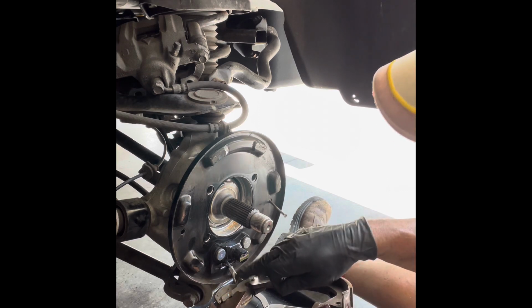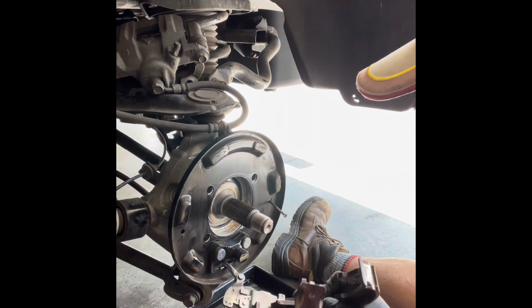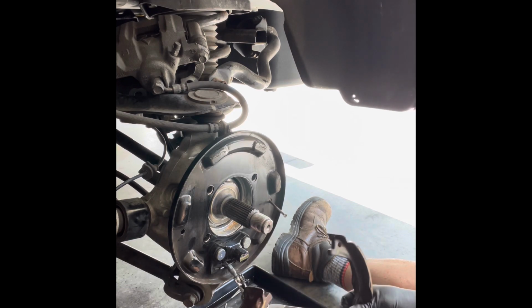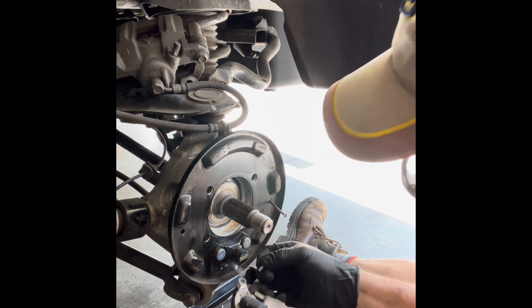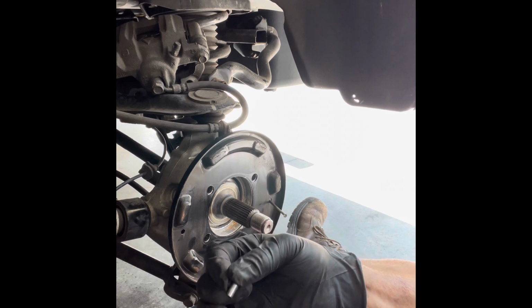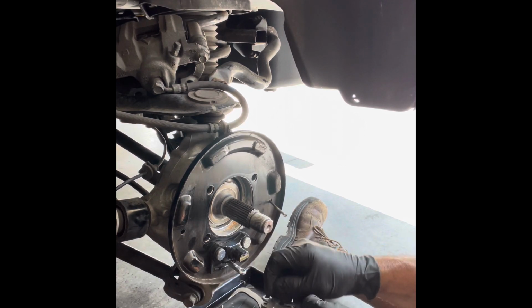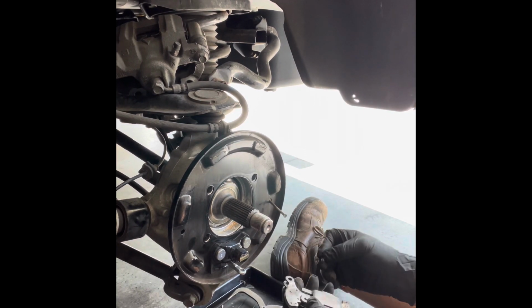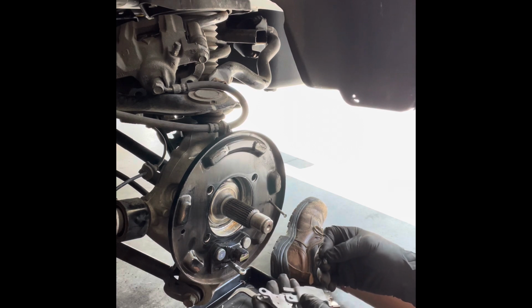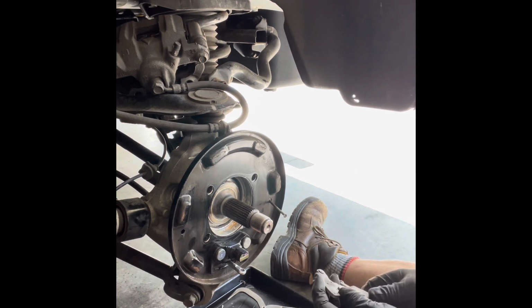There's the parking brake assembly, the cable. It's connected. Just kind of let it fall apart. Leave that in place. That's kind of a cool mechanism. It's got a pin. It comes right out. Okay, just boop. That's all it does, sit in there like that. Just make sure when it goes back, the pin is on the top so it doesn't fall out. It's kind of cool. I've never seen a mechanism like that. Interesting. Okay, we'll just put that back.